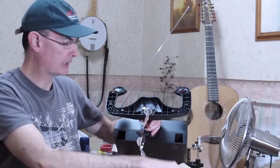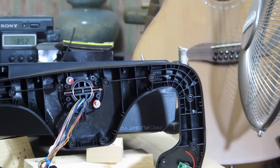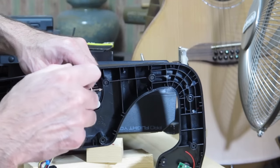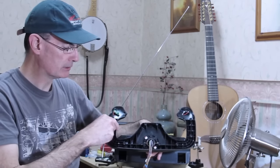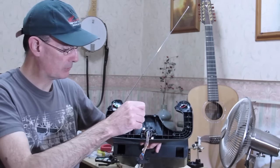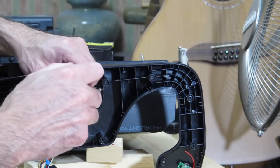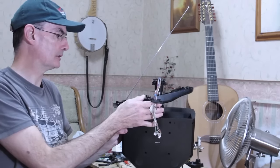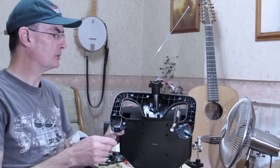Underneath that you can now see the end of the stainless steel shaft in cross section. What's revealed is four slightly larger versions of the same screw around the periphery. Two of them are removed and two are still in there. Those are actually holding the back plate of the handle onto the shaft. Once you've removed those, you'll find the handle just pops off, and then it's in the way, flopping about while you do the next bit.